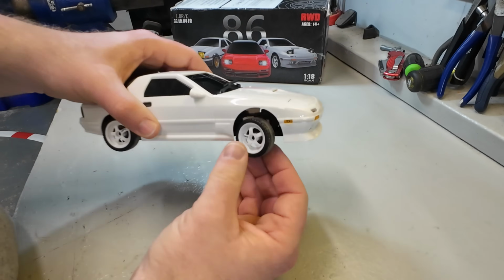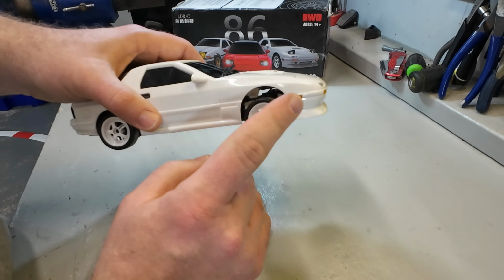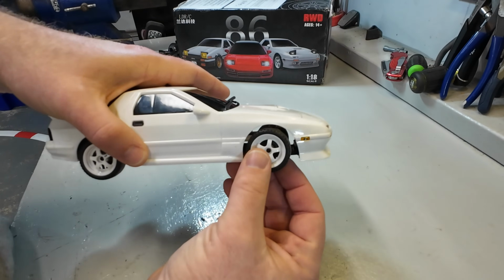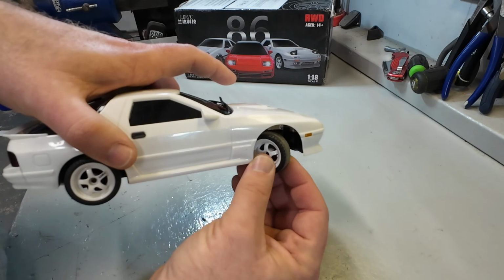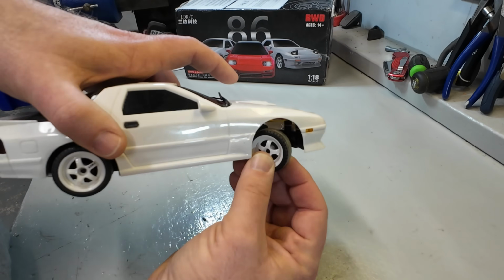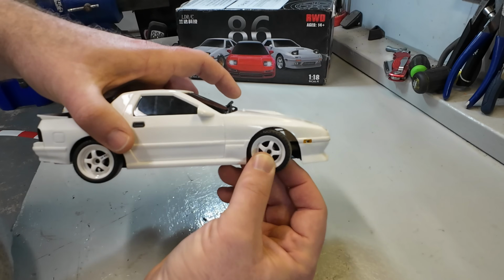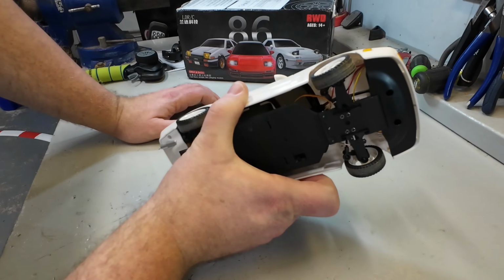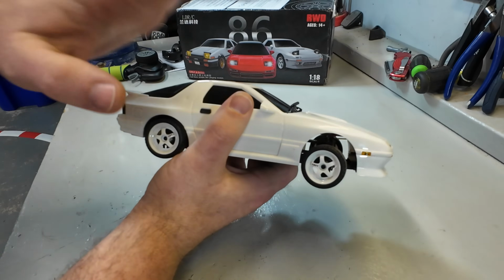If you have a high precision gyro, you get a wobble and it's just kind of doing this constantly. That's not what this was doing. It's like the programming that they have in the ESC is kind of a step. Is the angle past where the front tires are? Catch it, and then it comes back, and then catch it, and then come back, and then catch it, and then it comes back. And it kind of oscillates about that speed while you're turning. If we can put a better gyro in it and it eliminates that, that alone would be a huge improvement.